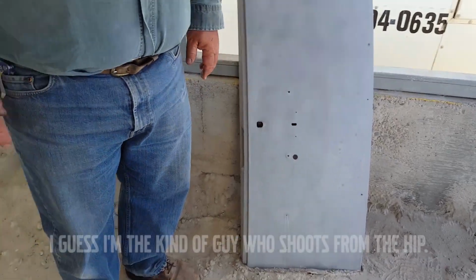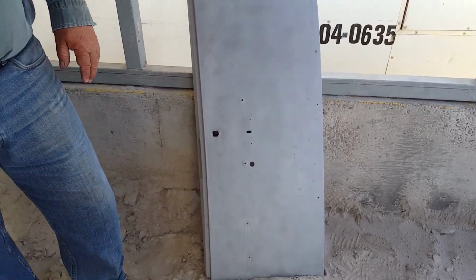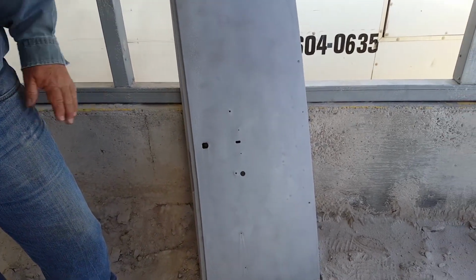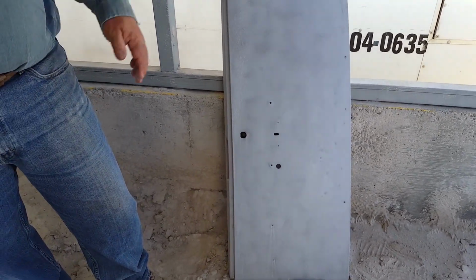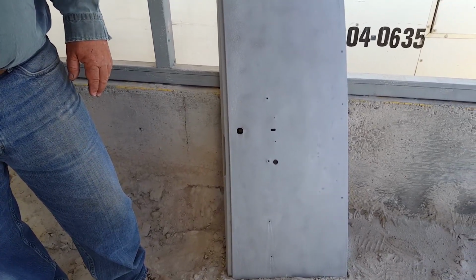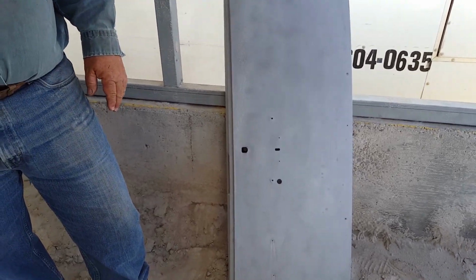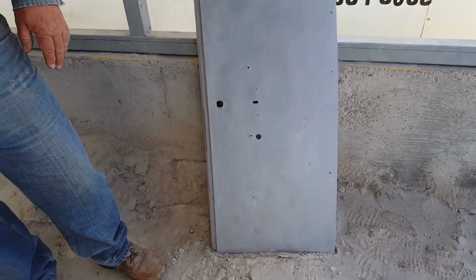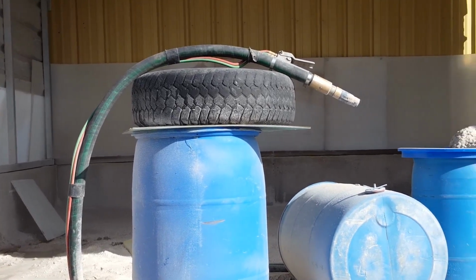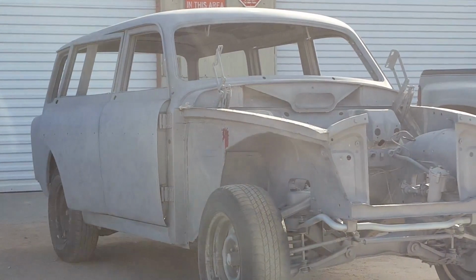The thing about the old Bondo, the new Bondo is so much better. Most guys, when they're doing cars now, skim coat the whole thing to make it look perfect. You know, skim coat it and block it. The whole thing's got a 32nd or a 16th of an inch over everything. And it looks straight as a board. They have a new primer that's like a polyurethane. It's self-leveling, thick like that too. That thick self-leveling polyurethane primer is mostly reserved for those quick insurance jobs. We're getting a full skinning on the entire car, but more on the paint later.